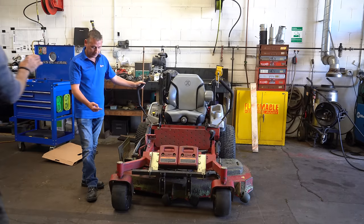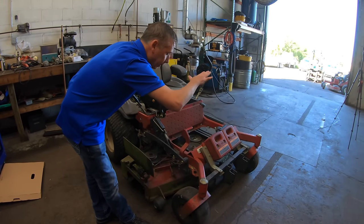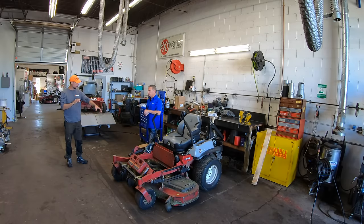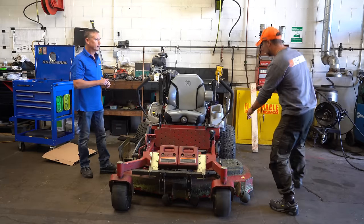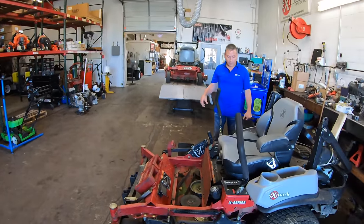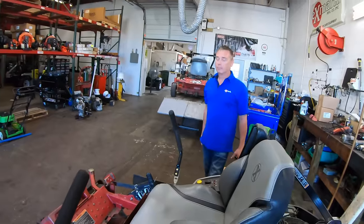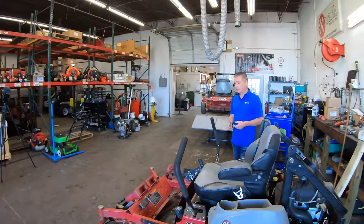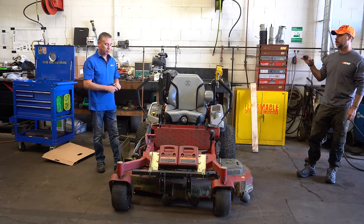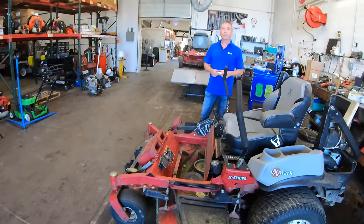Because there are no flat tires, basically the rubber wore off. Now the whole carcass supports the front end weight. That's why the front end is so low and the back end is pretty close to where it's supposed to be. These guys are out of adjustment and we can see they're maxed out — there's no more adjustment available. The next step for these guys is to replace the front tires. This machine has about 2,000 hours on it — that's like 90,000 miles on a pickup. It's time.